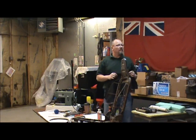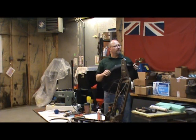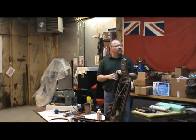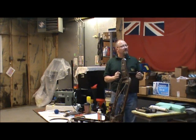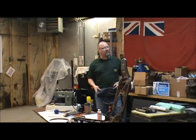That is very strong. I mean, if they put a fender on with it, and it adheres to just about anything. So it's expensive, but like the typical 3M spray, certainly I've talked before, it won't kill you, so it's probably not that good. But the panel bonding adhesive is very strong. There's another glue on the market that we use here sometimes. It's a 3M product called 1300. It's a very good aggressive glue. Doesn't seem to fade. Doesn't have the same characteristics of the 3M stuff.